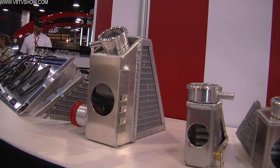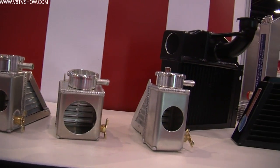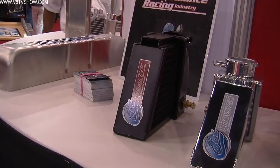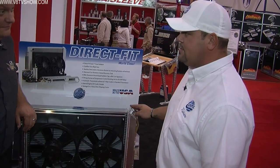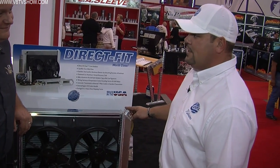The mounting locations are as original and the overfill can fits nice. I get the question a lot from people who build cars who say aluminum radiators are cool, but is it really a better solution than an OE-style copper radiator? With our radiators, we offer a money-back guarantee that they'll drop 20 degrees over a stock copper and brass radiator — much like your Camaro came from the factory with — simply by bolting this radiator into the factory holes of your core support.